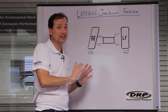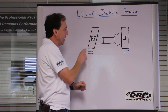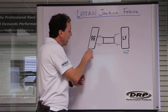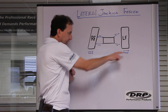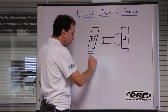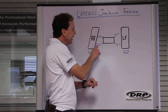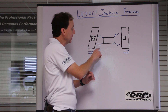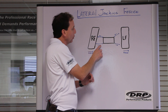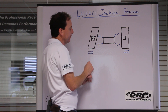The right front works the same way, except everything's opposite. On the right front when you go into the corner, the right front tire rolls up under the wheel, so the force is pulling to the left, pulling the right front tire under. On the right front lower, we're not pulling on it — we're pushing on the lower. So on the right front, you're pushing on the lower control arm and pulling on the upper, exactly opposite from the left front.